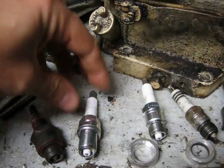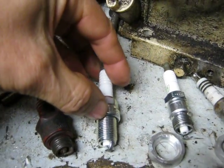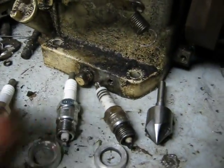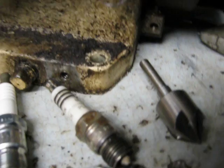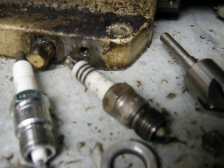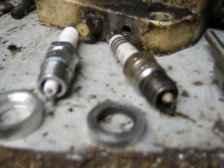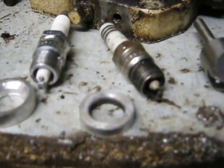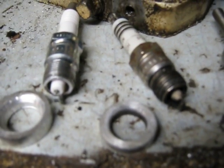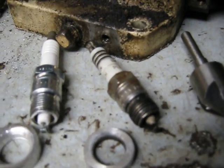There are a couple of ways you can approach this. This type of plug and the normal Briggs plug uses a gasket. But my son actually did this the first time a few years ago — he used a small Bosch spark plug that has the tapered seat. He made this spacer on a lathe. It's about one inch diameter, and to clear the threads he used a 9/16 drill bit. You could go smaller than that, but it's a common drill bit size.